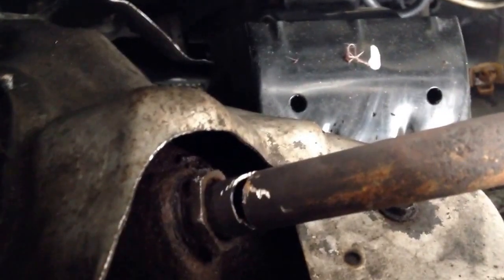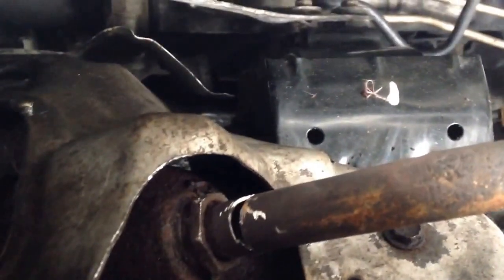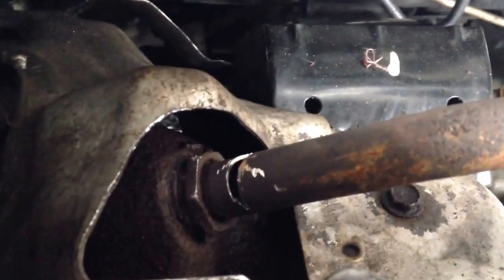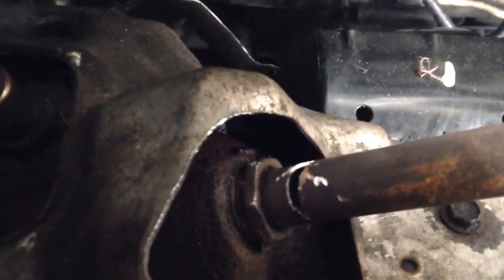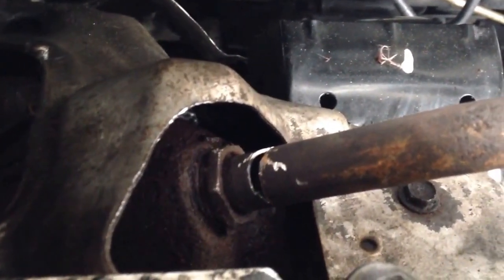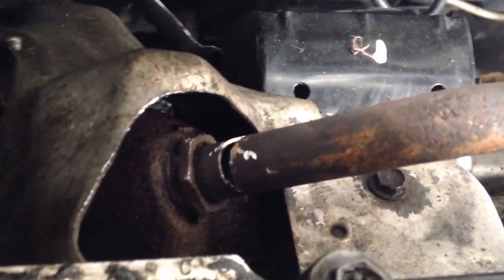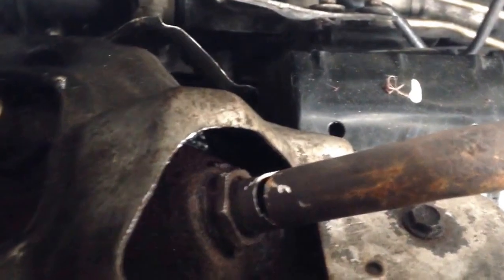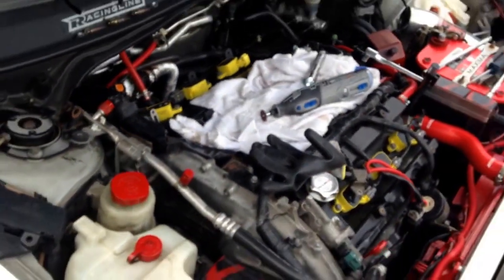So, like I said, I really couldn't get anything on the rear back here. The crowfoot wrenches that I had were too small. Like, the biggest size I had was a 22, and that was too small. So this might be a 23 millimeter, possibly. That's what I might lean towards, but I'll probably just pick up a 23 and a 24 size socket. And, yeah, team, I'm going to just finish cutting this off. We in here. And, yeah, get back to y'all, let y'all know how I go down, man.